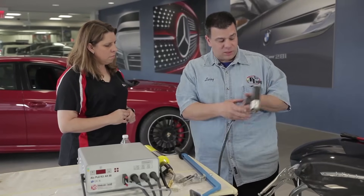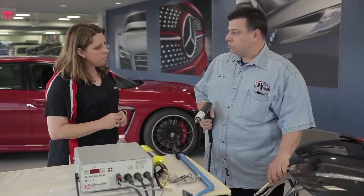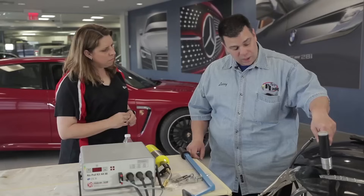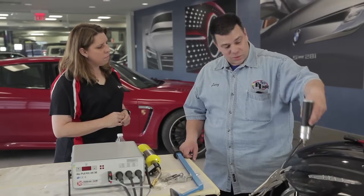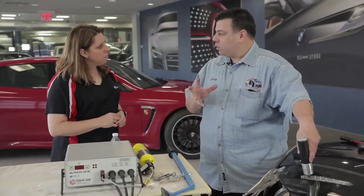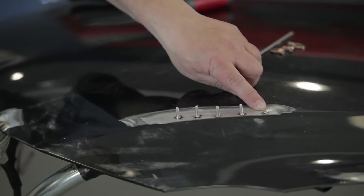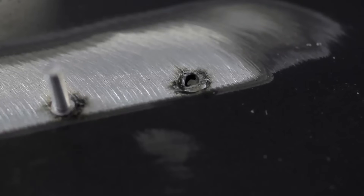This isn't plugged in, but you'd need to clean the area, and based on the equipment you're using, they usually have two grounding work clamps. You aim your spot where you want, but as soon as you touch it, it's going to weld — so you have to be very careful. You line it up, get it down, push, and it makes one sound and that's it. Then you pull the gun off and you'll have a pin sitting there. There was a hole blown here that we purposely did the wrong way to show what could happen, because now this panel is ruined.